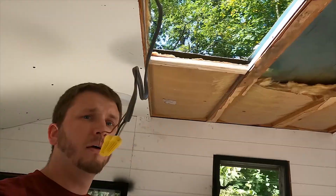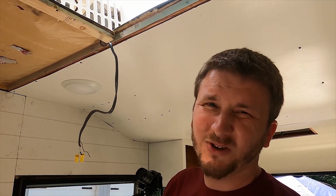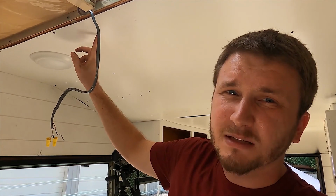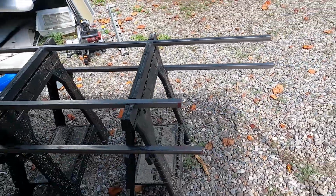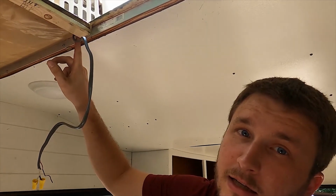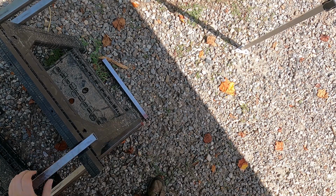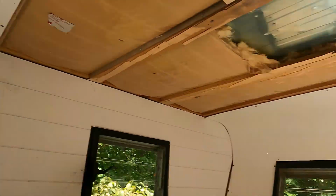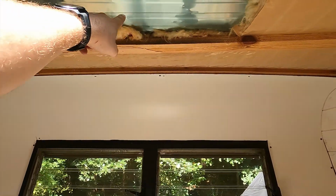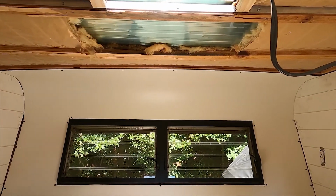Well, guys, I went up to Lowe's, and they only had 6 foot and 4 foot sections of steel, and the stretch from this side to that side is 78 inches, which is more than 6 feet. But I don't want to take this board down, so I'm going to use a 4 foot piece and cut off the excess and go from the wall to our square bracket here on both sides, and then use that excess, weld it onto a 6 foot piece, and use it on this support that I do have access to the backside of. I'm also going to put a second support right across the middle here, because that had a good bit of a dip. So a little bit more support would not be a bad thing.